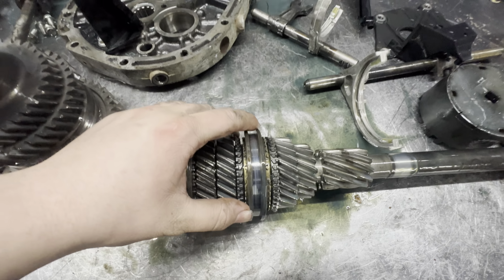They definitely can get worse. This is an example. I just replaced this on a customer's transmission where the fork pads were completely gone. Yours are not completely gone, but I'd like to replace this just so that we know we're at square one on this, and I'll get all the proper crush washers swapped for their respective ones. Outside of that, I didn't find anything else that would have caused a catastrophic failure or any kind of major failure in the transmission.